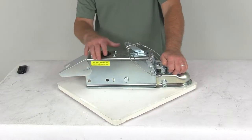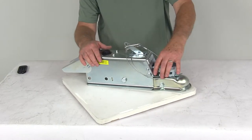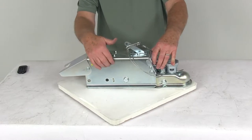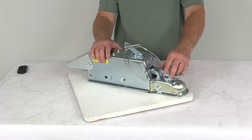The actuator is mounted on the trailer tongue and it'll telescope right in here and apply force to the master cylinder, which is underneath right in here, which in turn will supply the necessary hydraulic pressure to engage your trailer brakes.